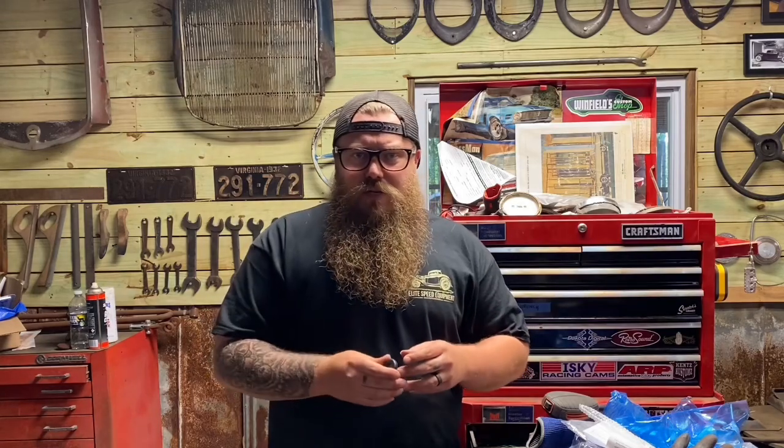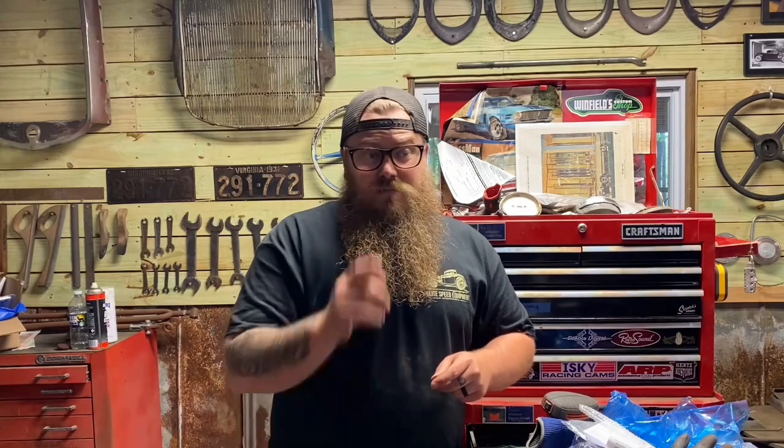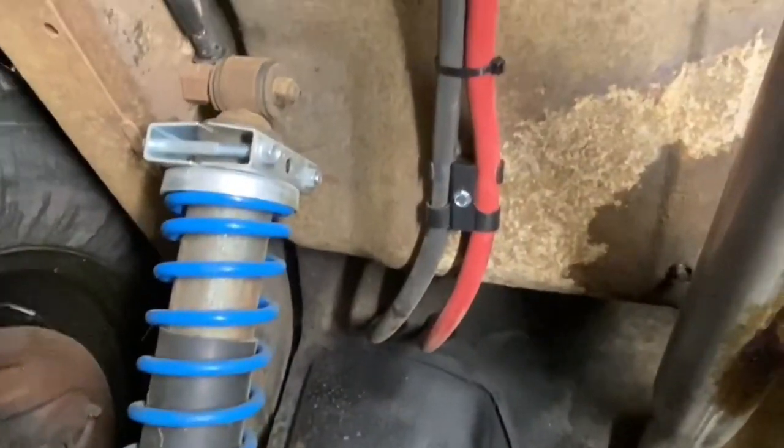This is a good, affordable option — you can get these grommets on Amazon. On a higher-end build, there are also bulkhead fittings for electrical, brake lines, and connectors that plug right into the firewall. You can really go down a rabbit hole and invest a lot of money into that for a super custom electrical build. For this standard build, it works great — there will be one solid, uncut wire from the battery fuse box all the way to the starter solenoid.